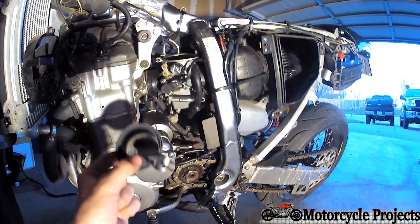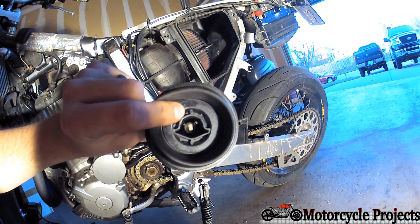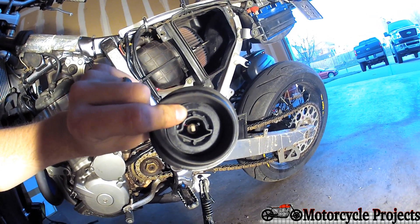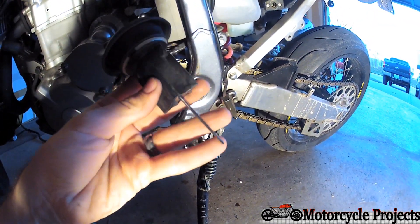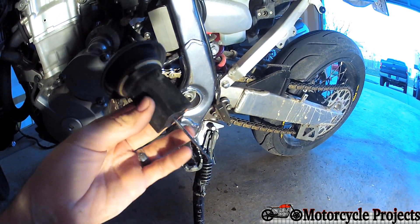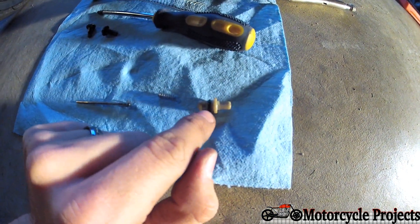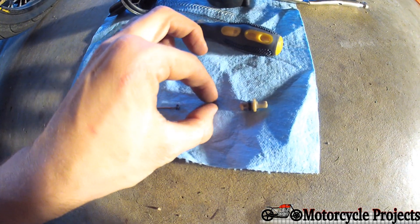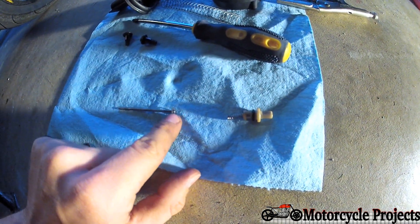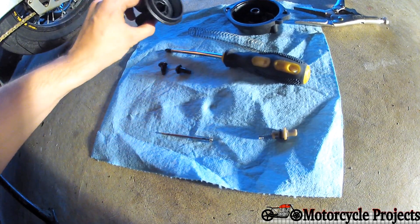It's a minor enough issue that it probably only needs one slight change on this slide. There's a retainer here — we're going to pull that plug straight out. It's not screwed in; it just comes straight out. Pull it out gently with a pair of needle nose pliers. At the top of the needle are some grooves that a C-clip goes into. There's the retainer at the top with a little rubber O-ring, which helps hold it into the slide assembly. There's a spring which pushes up against the retainer and the C-clip on the top of the needle, helping make sure the needle is pushed down and coming out of the hole the full distance needed.